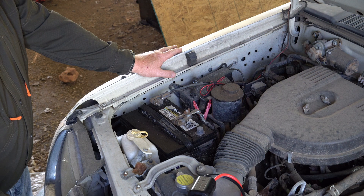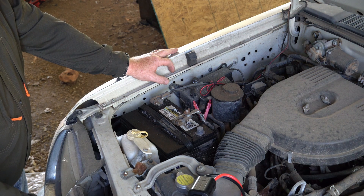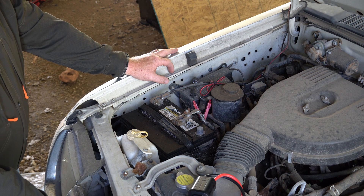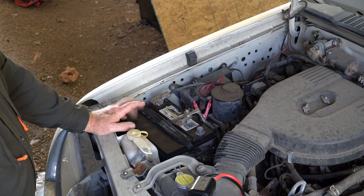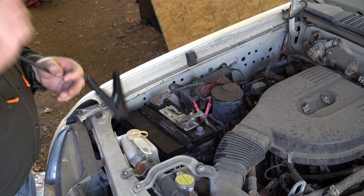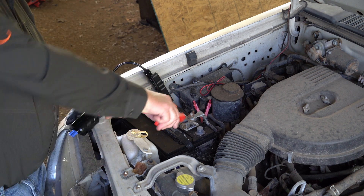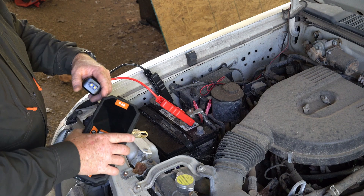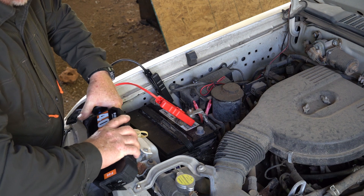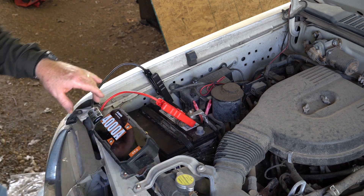So this is my old 1998 Nissan Frontier pickup. It's an old vintage vehicle that I like to keep around. It's got a standard shift on it. I just keep it around the farm. I don't use it a whole lot and the battery goes dead on it a lot. So once again I've disconnected the positive battery cable, so there's no power to the system. We'll go ahead and connect the negative and the positive here. Let's go ahead and plug this in. We see the green light — let's go give it a start.